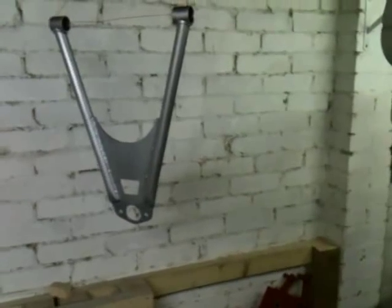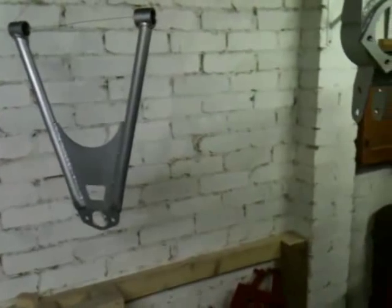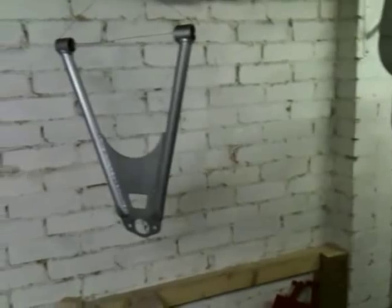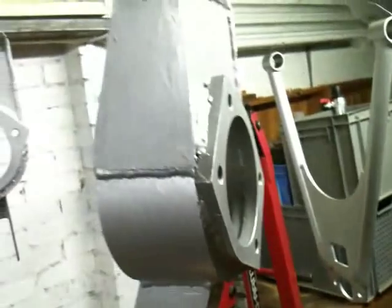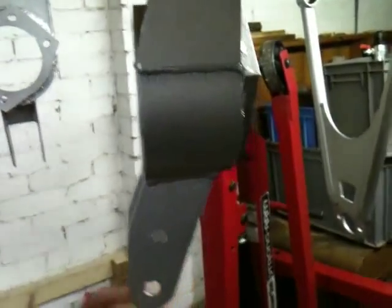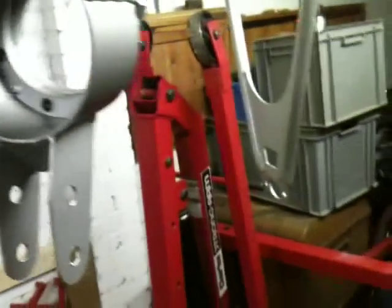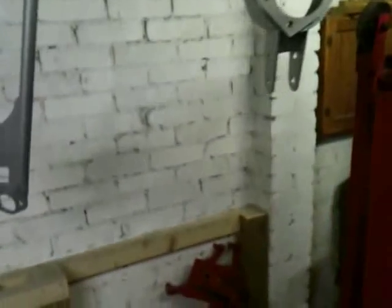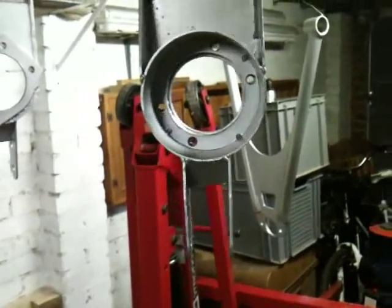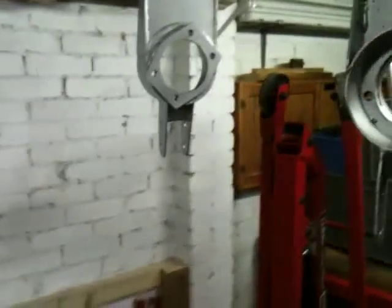The wishbones, on the other hand, are pretty nice looking - nice and shiny, all painted, ready to go. The hammerite does take longer to dry fully on the epoxy mastic - it takes about two days to fully cure and set. Those ones up there took the same amount of time. I tested it with a hammer and smacked one just to see if it would chip, and it didn't do anything. So road stone chips aren't going to do anything either. I'd highly advise this combination, though I'll have to see over the long run how running it affects it.